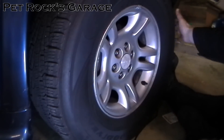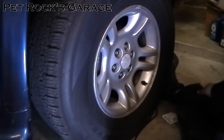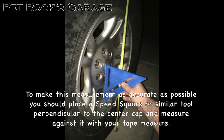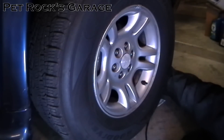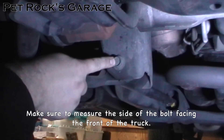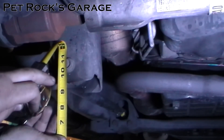Now you want to take a measurement. While it's advisable to have the tire fully inflated, it really doesn't matter. This measurement works regardless of what size tire or rim you have installed, mainly because it works off of center points and a delta or difference between those two points. Take your tape measure and measure from the floor to the center of your center cap. In my case it's about 14 and a quarter inches. Then underneath the truck, measure the distance from the ground to the center of the rear lower control arm bolt head, which should be the one on the inside. In my case it's about 10 and 5 eighths inches.